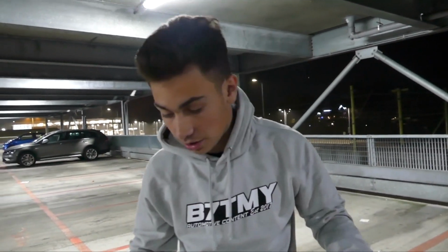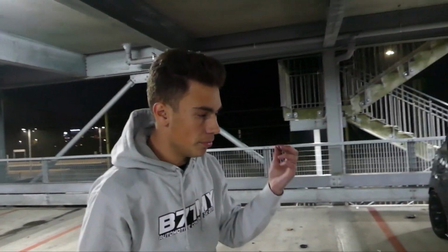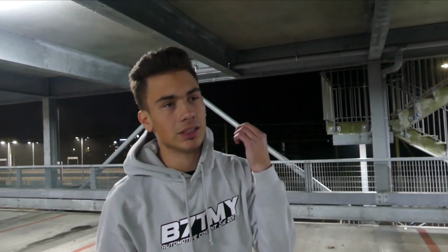Obviously, I can't say much yet, but the main thing is I've got an engine light. It's not a spanner, so it's not a maintenance light. It's an engine problem, which obviously is not good. But what's confused me is there's no limp mode. The car doesn't feel sluggish. It still feels fully powerful. I was driving on the motorway, went into the petrol station with no engine light, turned it off, turned it back on, had an engine light and it won't go off.